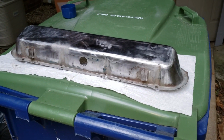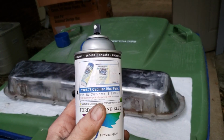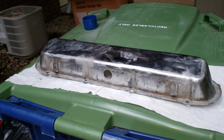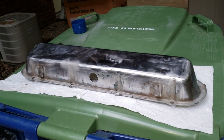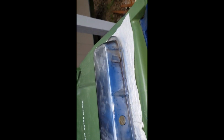Well, all right, we're back to the trash can, but this time for Cadillac Blue. I'll put a link in the description below for this can of paint that I bought online. It's 16 bucks a can, but I think it'll be worth it to get the car back to the original color. So here we go. Of course, whenever you spray paint, your first coat is going to be a very light dust. It's to give the rest of the coats something to stick to.